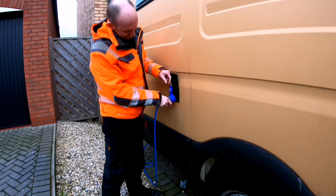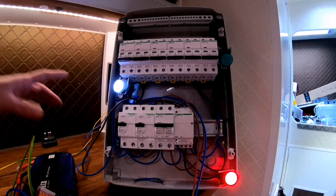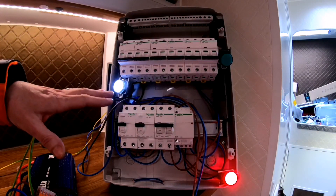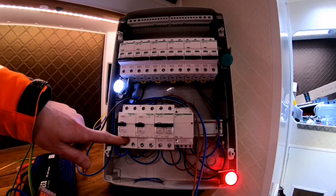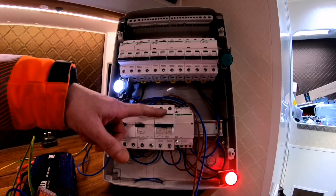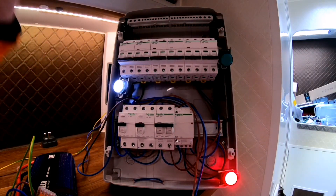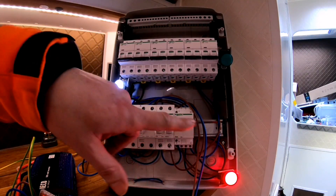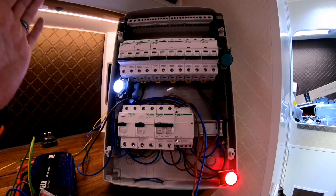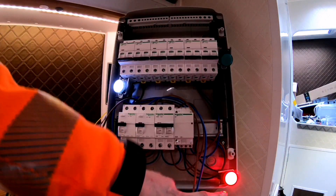Now we'll come along and plug in at your campsite — so your hookup goes on. Your hookup's powered up. The white light represents power coming into the board, just so you can see what's going on when we're tripping RCDs. So your power comes in from the hookup through the RCD, then goes to a breaker which is purely there to protect the coil, so if the coil on the contactor were able to burn out or go wrong, it wouldn't burn your full board out. We've now switched from its standard state — normally closed — to its powered-up, energised state, which is normally open. So it goes from closed to open, which then feeds onto the red, which represents that you've got your shore power.